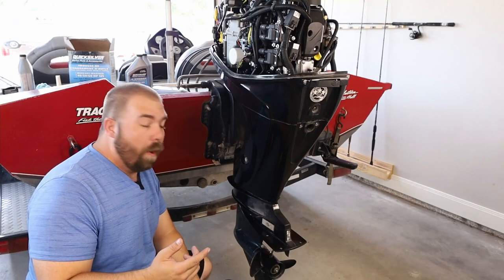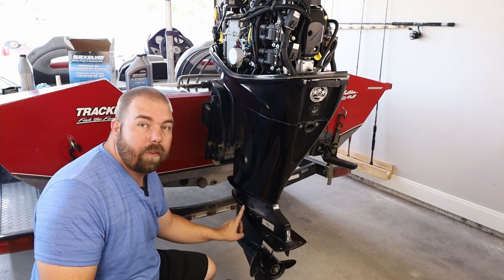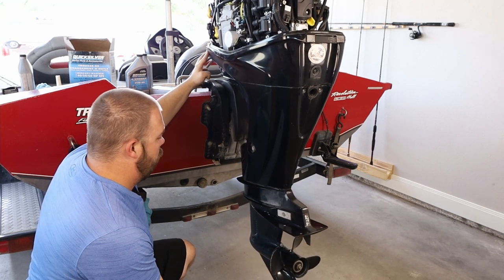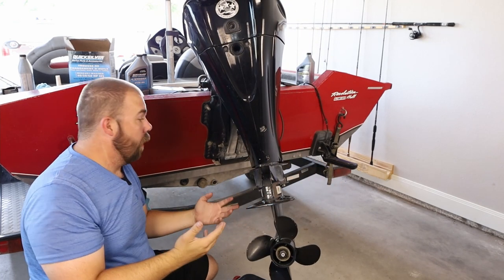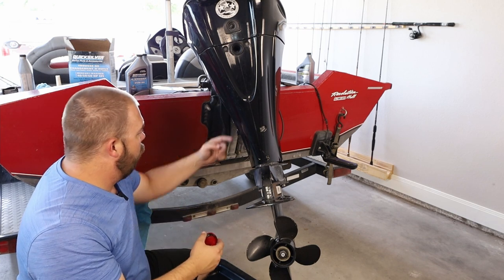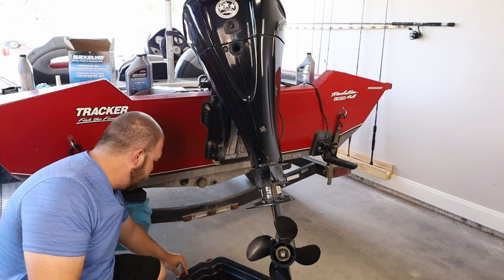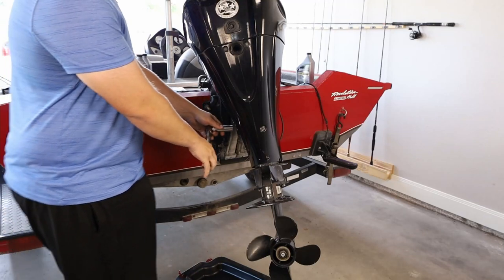And lastly, still on the left side of the engine, you have your drain plug here — halfway between the engine and the foot. To get started, I need to get my oil pan underneath and angle my engine so the oil doesn't just drip down the side. I'm going to trim up and angle the engine so the oil flows straight out. Position your oil pan out wide because it's going to flow far at first, then shorten up. If you have an oil pan like mine, make sure you pop the little air vent, otherwise you might end up with a mess.